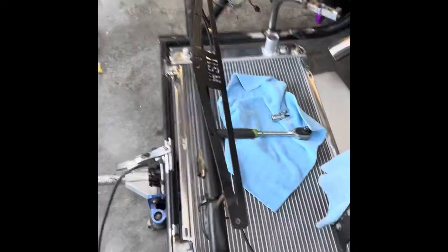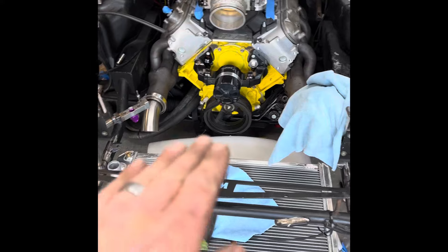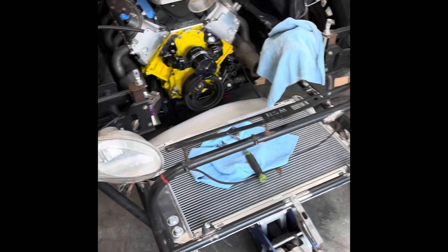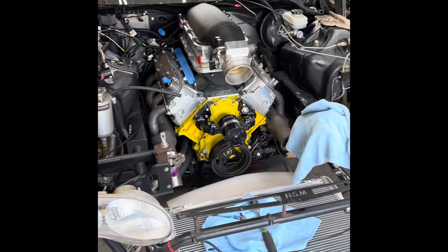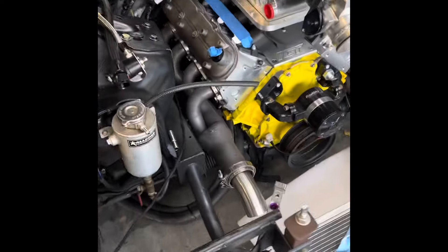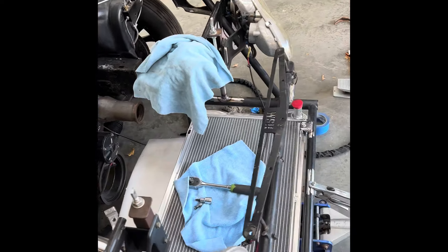So we've got our two tabs welded there and I need to finish welding them out when I can get to a better area and get a cleaner, better looking weld. But what I'm going to do now is build a cross brace for that, angle it down to where it meets flush with the radiator, then up and back over for this side. The radiator will be mounted and I'll make sure it's really sturdy. I may add one or two more mounts just to make sure this thing doesn't go anywhere. It's not the lowest point of the front end, so it is higher than everything else — the subframe and stuff clears it, so we're not worried about it hitting the ground. So I'm going to have this mounted and then start on the pipes from the manifolds going to the turbos and then exhaust, cold side, and wastegate placement. Check us out on the next video.